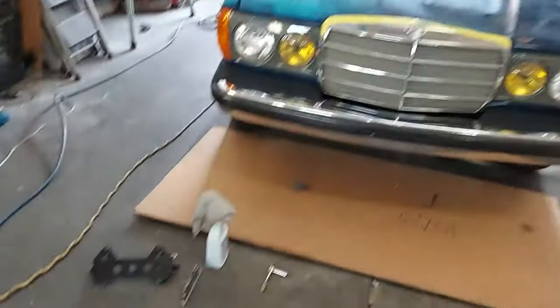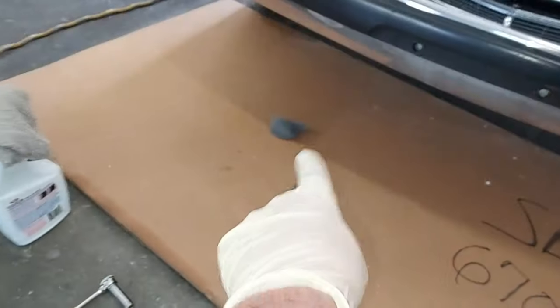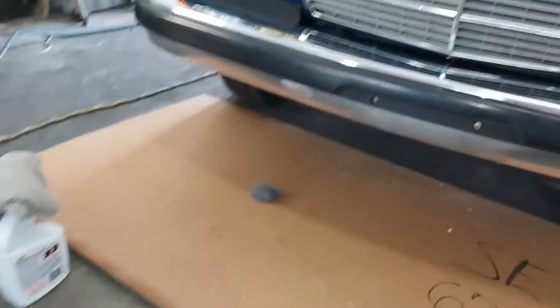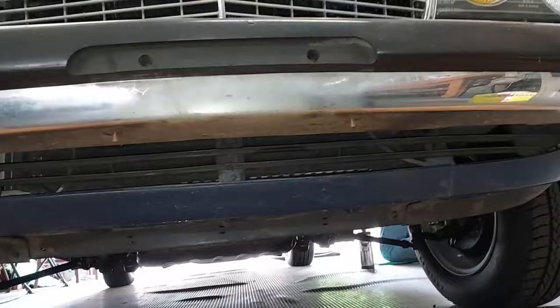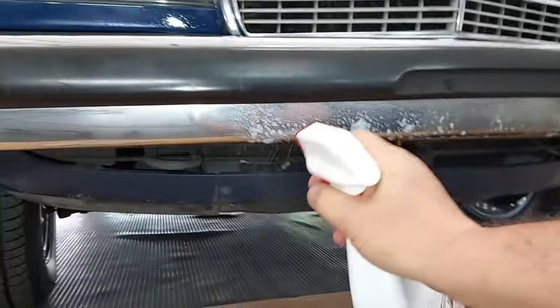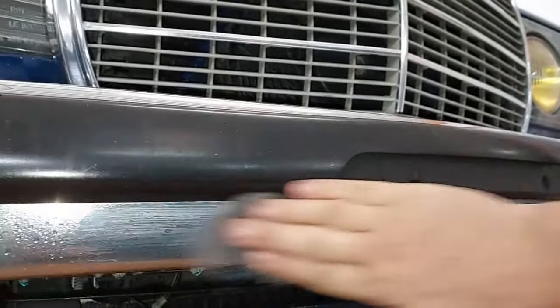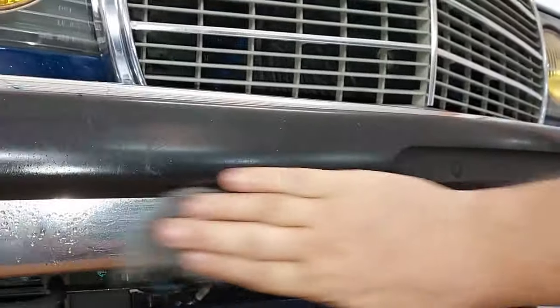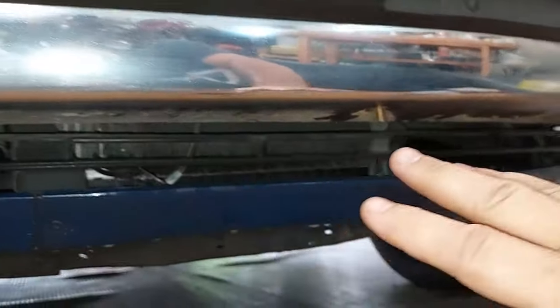While Scott works on the paint, I've removed the front license plate holder and I'm going to get under here. I'm using Bleach White and four-aught steel wool with a rag to start cleaning under the bumper and front valance. Bleach White works awesome for this. As long as it's four-aught steel wool it won't hurt the chrome bumper. I'll do a small section and wipe it off to show you guys how nice it makes it come out.